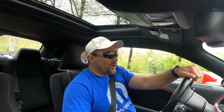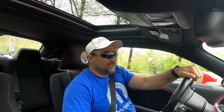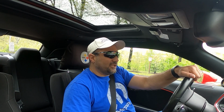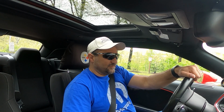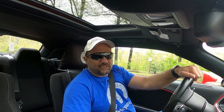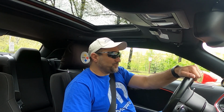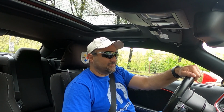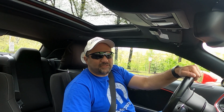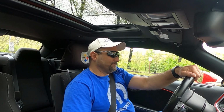Yeah, I started with a throttle body, cold air intake, and exhaust. So my first exhaust setup, I cut out the mid mufflers, put in Flowmaster 40s, and cut out my resonators. You could call it a poor man's cat-back. So for about 300, 400 bucks, I basically had a one muffler setup.